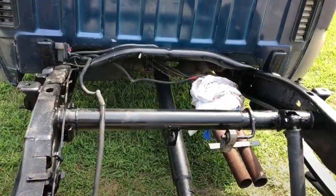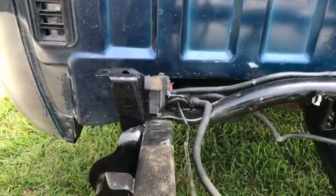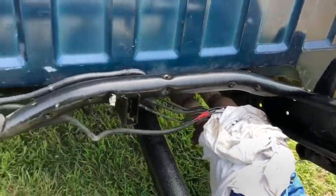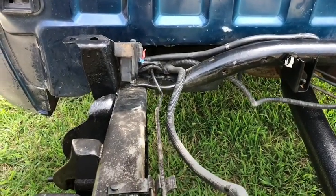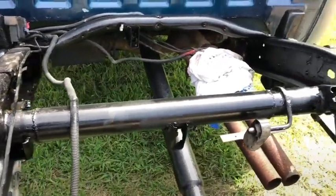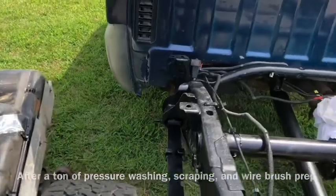All right, so here we went ahead and we replaced the front tank support Crossmember. This came from a donor vehicle, and you'll see we've got, like I said in the last one, grade 8 7/16" bolts. It did take a little bit to grind off the rivets out of the back underneath and then pop them off, but then we just put a coating of frame paint on, and now we're getting ready to hang the gas tank.